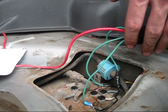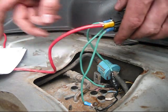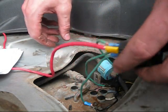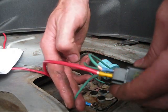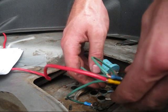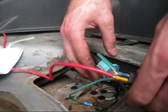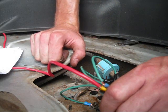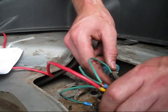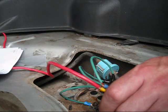And you'll see it on the schematic — it's coming from the battery, that's where this wire is coming from. There's a 30 amp fuse back close to the battery that I wired in. That goes to number 87 on the relay. Then we have the ground, that's going to 85 on the relay, and that's just hooking into one of the bolts on the fuel pump. Then the black and blue wire is the only wire you're going to cut — you cut it in half. We're going to run the harness side, which just means the side that has the plug, so the wire coming out of the plug goes to number 86. And then the other half, the wire that goes to the fuel pump, goes to number 30. Good luck.